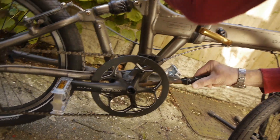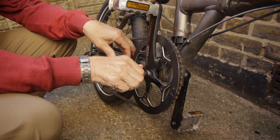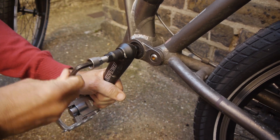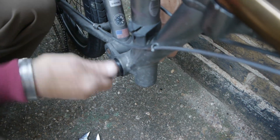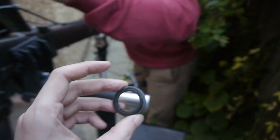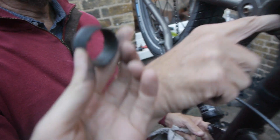First thing to do is remove the bolt on the chain ring — that's an Allen key size 8. After that, use the crank extractor to remove the chain ring itself, and you need to use a size 8 Allen key on both sides. There's also the lock ring — one on each side — and use a bottom bracket tool, the grey tool, to remove the entire axle unit. There's another lock ring, and also an inner ring which was part of the Dahon bike — not necessarily on any other bike — but the Dahon has this kind of spacer.